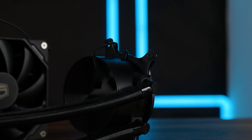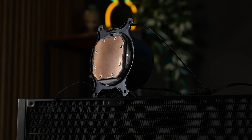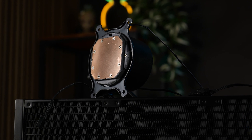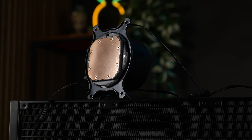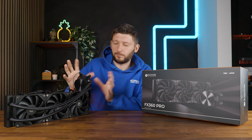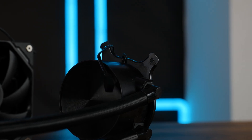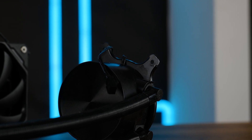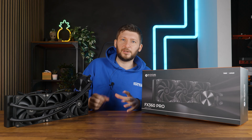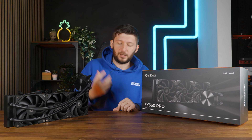The pump is the one thing that I am not as happy about. It's spinning on top of the copper base at up to 2800 RPM whilst using a 3-pin voltage-controlled connection. But it's not the voltage-controlled connection that bothers me — it's the fact that I can hear it. It is a subtle whining, not very loud. It isn't even really picked up by my dB meter during the noise test, but I hear it slightly and I shouldn't.